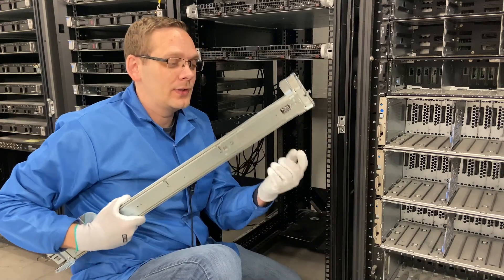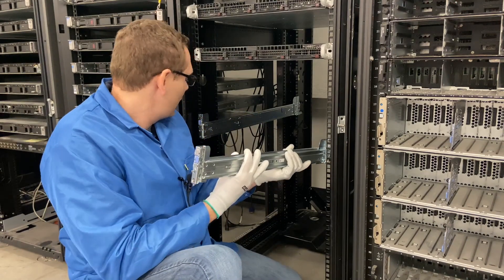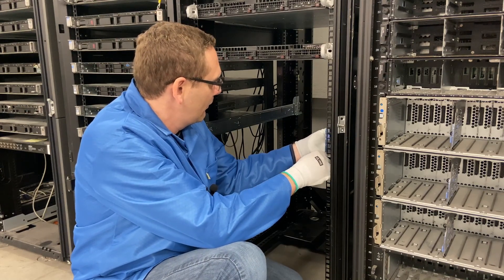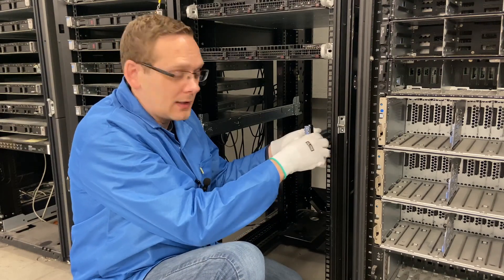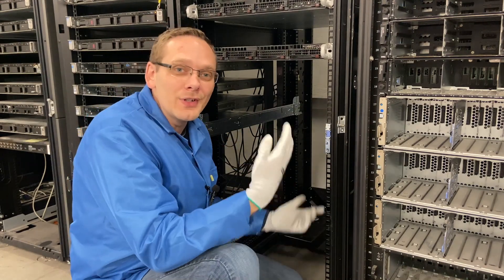So we're doing the right rail now. You'll see it says right and you want the right facing up. We are going to face it like this. Angel, we're going to do 14 and 15 again — go ahead and line yours up first. So I'm just going to take these two pegs again and put them into 14 and 15, line them up perfectly and just push it into place. It's really just that simple. So now we're going to show you actually how to put your server into the rails.